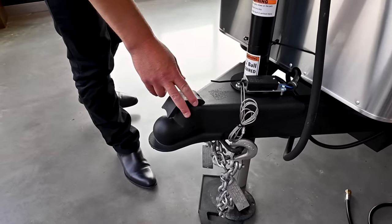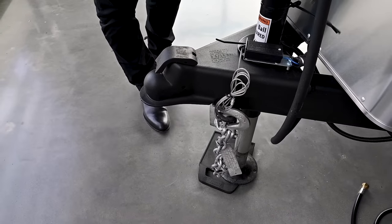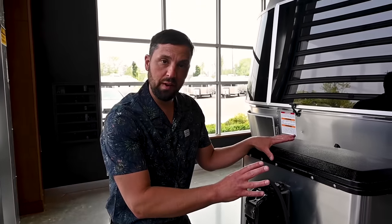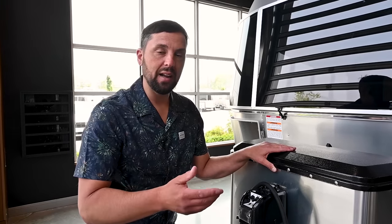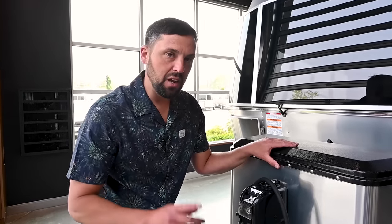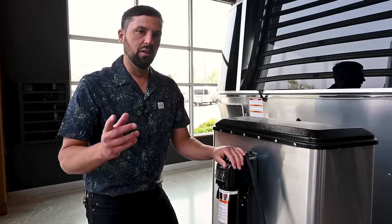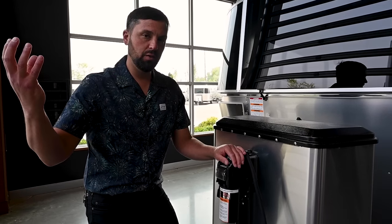There's a 2 and 5/16-inch ball up front with a 565-pound hitch weight capacity. You always want to confirm your tow vehicle's maximum towing capacity — this trailer is 5,000 pounds GVWR, so make sure your vehicle can tow that or more. Be mindful of your vehicle's hitch weight capacity of 565 pounds, and find out if your vehicle is compatible with a weight distribution hitch. Also check your vehicle's payload capacity — add the hitch weight, your cargo, aftermarket accessories, and passengers together; that total cannot exceed the payload sticker in your driver's door.